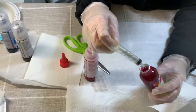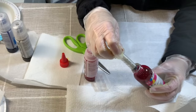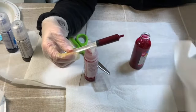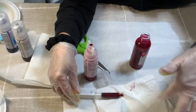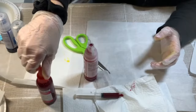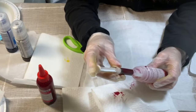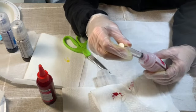I'm going to use a syringe and put it just at an angle when you're trying to suck up the ink, because you don't want to get bubbles in it. You want to go super slow. I'm going to set it on a paper towel, because keep in mind this was in there so it has ink on it. I always like to put the lid back on — very important, because it just takes one second to accidentally dump it over. I've done a couple of these and I've noticed I just do it super fast and that works.